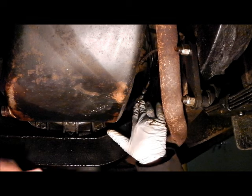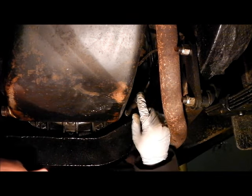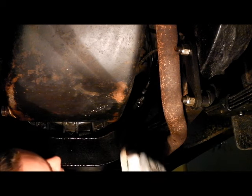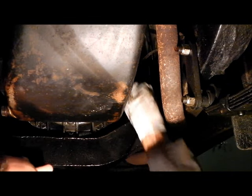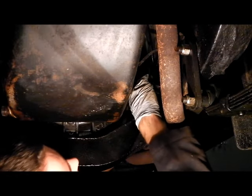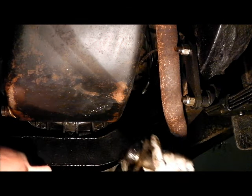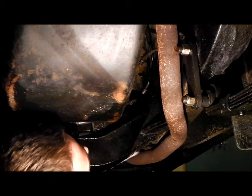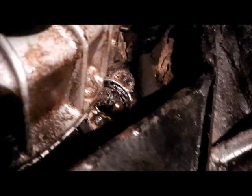The old slave cylinder is a bit of a swine to get to, but with a socket and an extension bar you can get your ratchet in there on both sides. There's room to swing it between the sump and the exhaust. Wind the bolts out a little way and it looks like we can just pull it straight off. There she is. The push rod is just sitting there - that's what you should be left with and that was the thing I couldn't find any information about. It's not necessary to try and remove that; you just pull the slave cylinder right off.